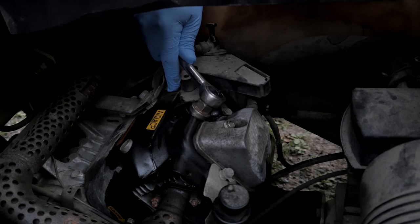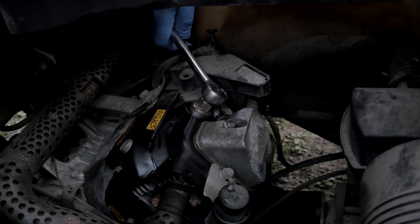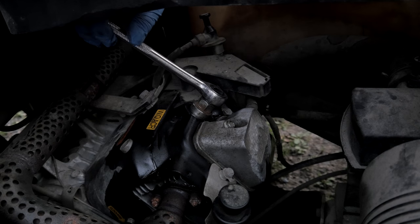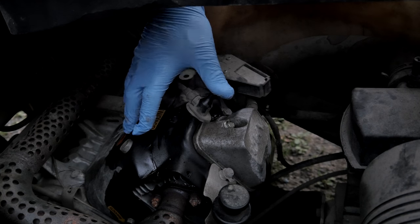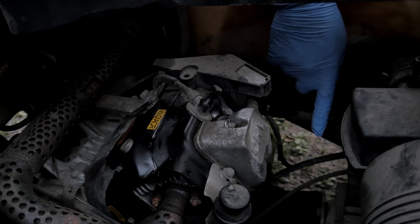The symptom here is the carburetor was basically stuck open - debris was getting past the float and past the fuel filter. So we've got to pull the carburetor off, change the fuel filter, and add a fuel filter down here.